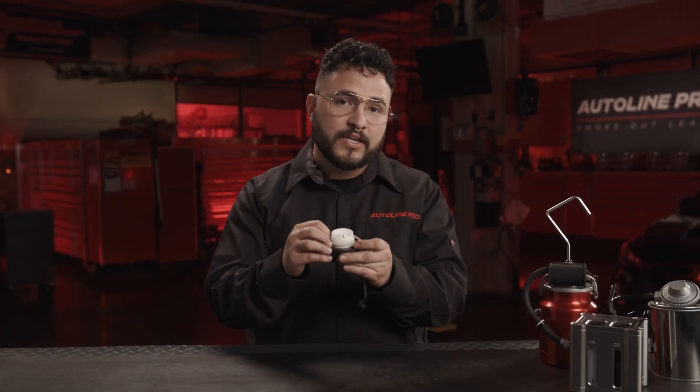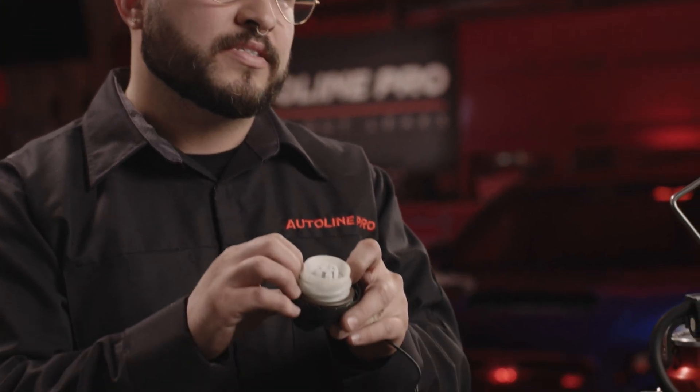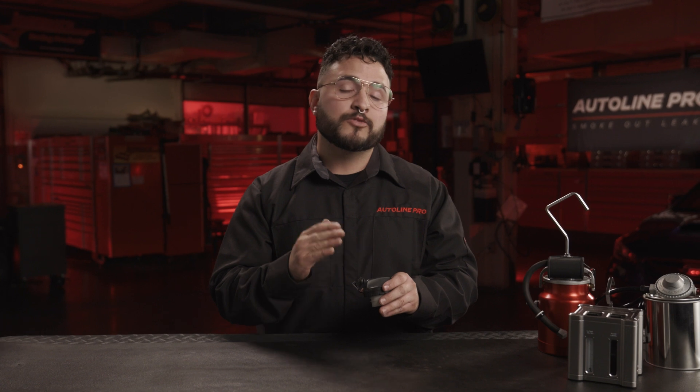When you check out the gas cap, ensure that the O-ring is still thick and showing its appropriate diameter. If the O-ring seems too flat, it's probably not holding its seal and must be changed. On newer vehicles, the gas cap is completely removed and replaced with a flap design with a return spring. The principles are still the same — there's a seal around that flap, so ensure that the return spring is seating the one-way flap all the way. If the spring is worn out, fumes may be escaping.